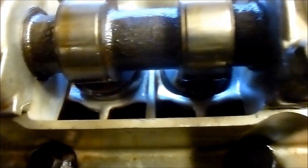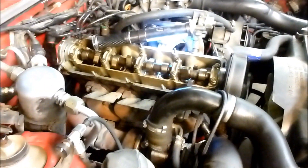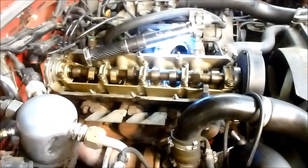There are these little buckets directly underneath the cam, and there are replaceable shims there. As the valves wear, they'll usually go deeper into the head, which throws off your valve adjustment, and the valves end up staying open causing a compression loss. I'm hoping to bring this car back — hopefully no valves are burned — and it's kind of a tricky proposition.